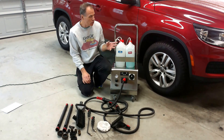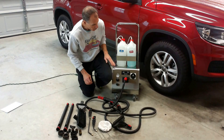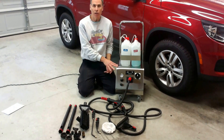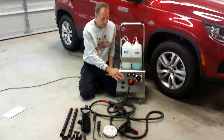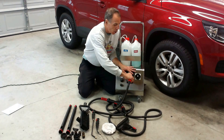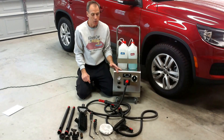The tanks are very easy to refill — you can refill them standing on top of the machine or take the caps off and refill them that way. You plug the machine in and it's going to take a good 10 to 12 minutes to heat up because we're using a fairly big boiler in this machine. Once it's heated up it's going to get to 125 psi and then you're ready to go. We have a detachable hose which simply unclips from the front of the machine — once you hear the clip, you're ready to go.